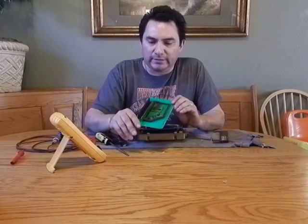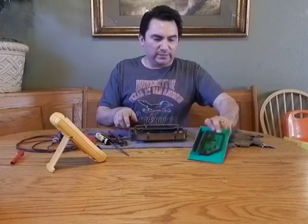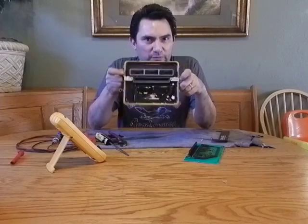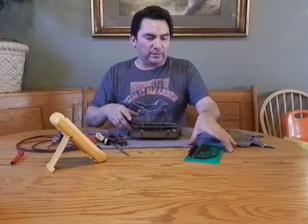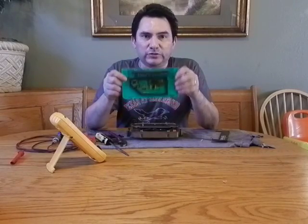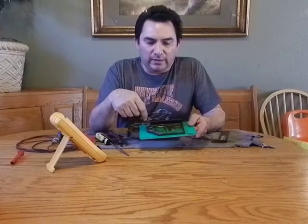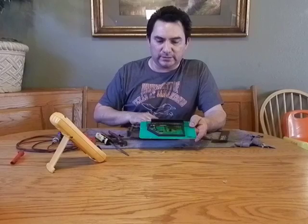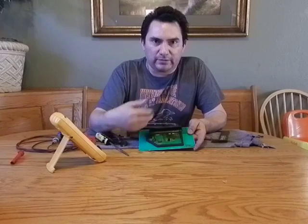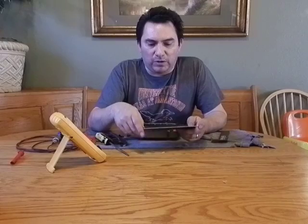Once you access that, you'll end up seeing that there is some electronics right here. The main part of the PCM is right inside of here — you can't see it because there's a lot of gel inside. But this is where the real brains is. On this side is actually the voltage regulator side. There are some voltage regulators inside of here. The 12 volts go into this system and then go down into this header, making five volts out of here and then pushing back out. Because the voltage is lower, it's a higher current, and that causes a problem to the header.